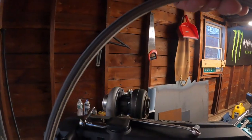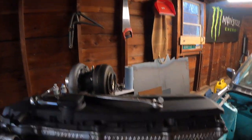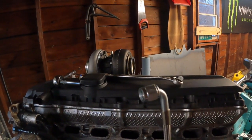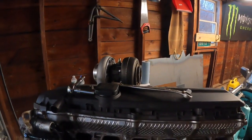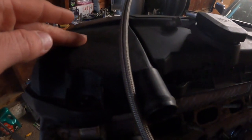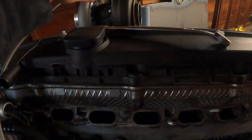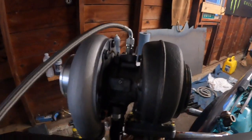Here's the actual 4AN oil line, which has 90s on it — it's just the best way it fits and you have plenty of room. The one I link in the description won't have any problems with any turbo you use. Here's how I like to run it: wedge it right behind this little breather tube that goes on the valve cover, then straight shot over to the turbo. Also, if you're running a stock manifold you can wedge it up through one of the runners if you need the turbo farther away, but usually this is pretty much where your turbo is going to sit.